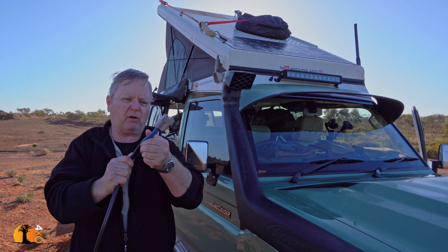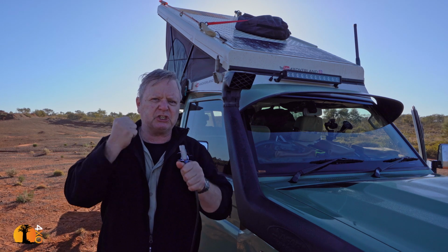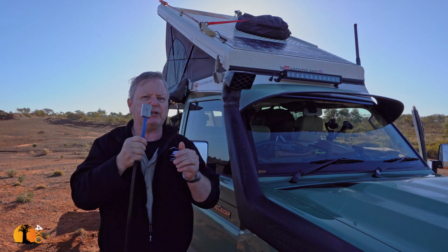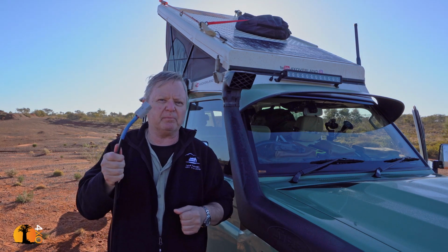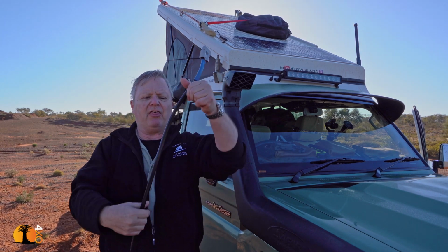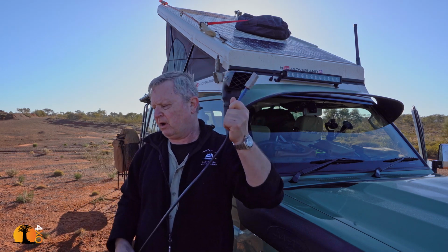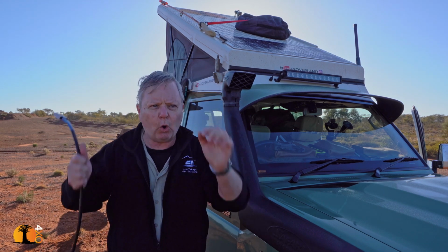So this panel here cannot deliver more than 11 or so amps, and yet I've got a cable that I made up myself, and of course Anderson plugs or similar, big, heavy, chunky cables. Andersons are great, but they're not good for permanent outside installations because they're not waterproof and they do corrode. But for our applications, where things are generally kept clean and dry, they're absolutely fine and ideal because they can carry a good current. That cable I have there could easily handle 60 to 80 amps over the 4 meter length. It makes an enormous difference.